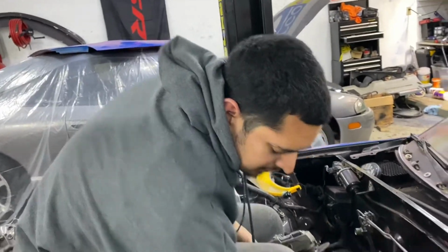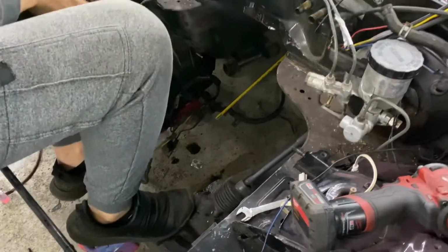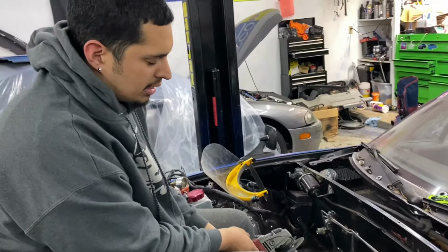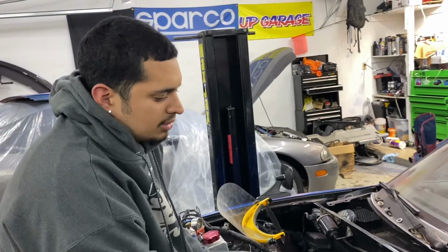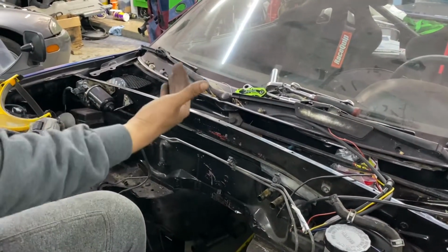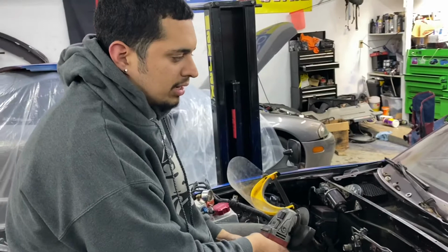They're around 3 inches further up, and the oil pan sits right on top of the steering rack still, and the oil pan is still too low, so I'm gonna have to buy spacers for the subframe, drop the subframe maybe a quarter of an inch, and make blocks for the motor mounts to raise the engine up. And the engine has to go in at least 2 inches deep, because the transmission is 6 inches away from the tranny hole for the shifter. It's literally 6 inches forward.